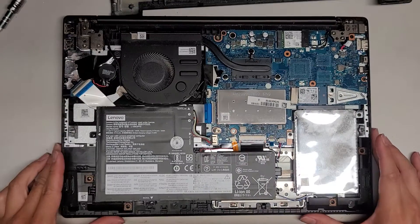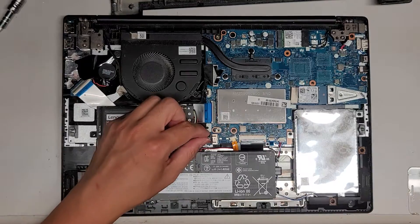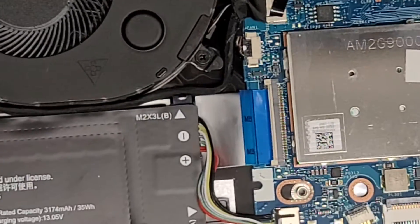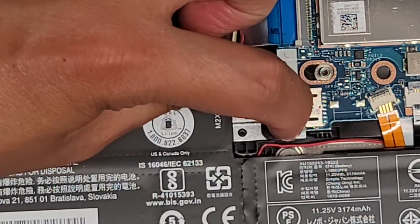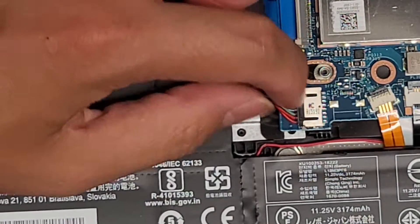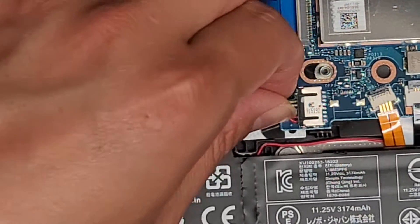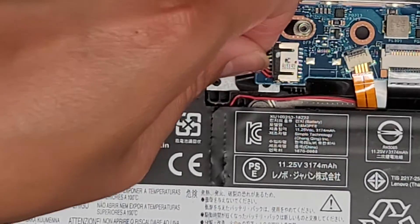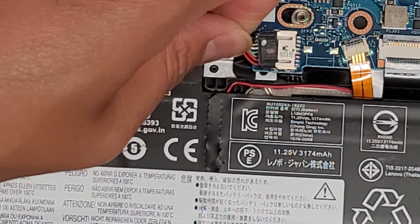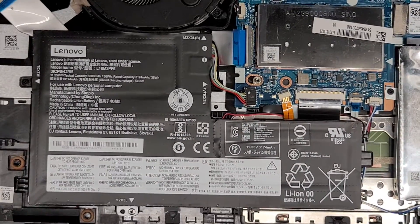Let's actually pop the battery out. The battery connector is right here — let me zoom in to show this a little better. There's a little area here you can kind of grab. Usually what I do is I rock the edges back and forth, but if you can't, you can grab the cable as close as you can and wiggle it side to side as you slowly pull it back — you can see it slowly walks its way out.